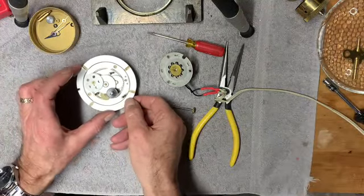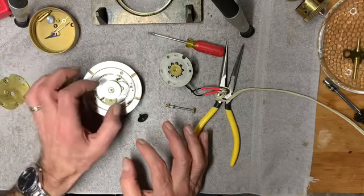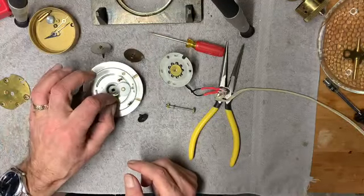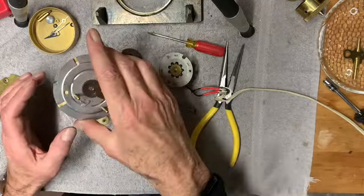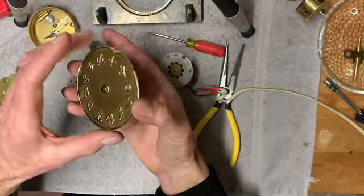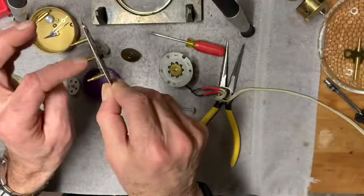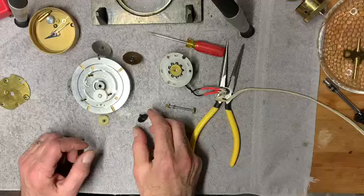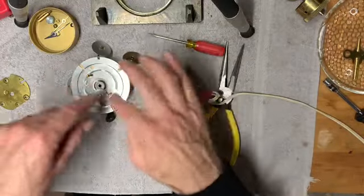Let me show how these come apart. Here's one, two, three, four, five. This one is riveted in place, so that's not coming off. And the other thing I'm noticing is that the face of the dial seems to be glued to this plate, so I can't remove that either. If I could, I'd look to thoroughly clean this plate — I'll just end up putting a little bit of oil around the edges of it. The rest of the gears, though, I can ultrasonic clean and get them nice and clean. And I'll take a closer look at the motor to figure out where I can apply some oil.